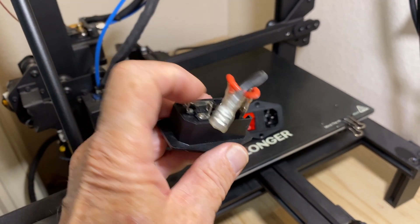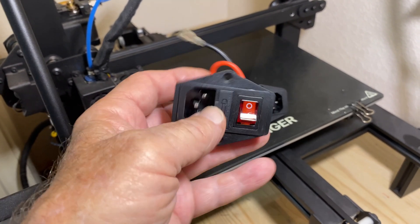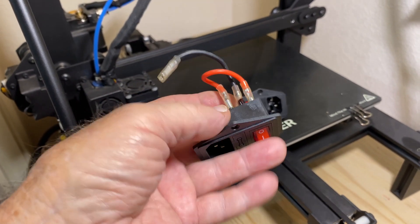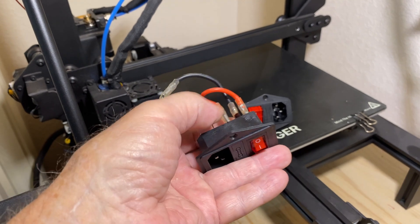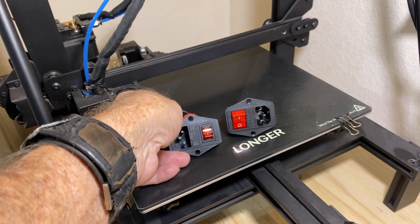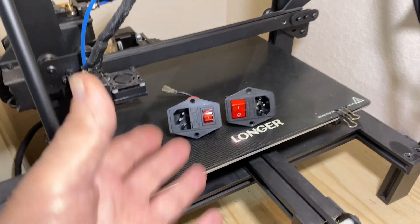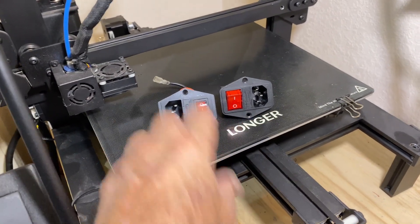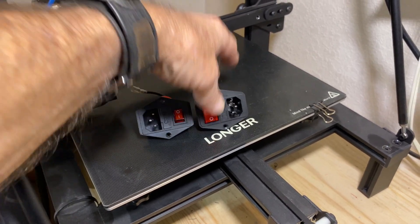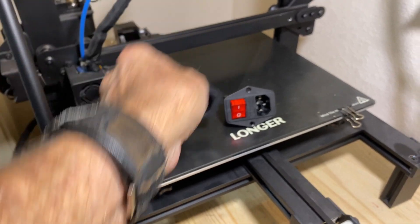What you're seeing there is burning. The other end, which you can't see here, is no longer used. I cleaned it up and reconnected to the new switch. The manufacturer figured out this was going on — there's actually a jumper to take the hot and jump it to the switch, which is a kind of fascinating way to do things. Here's the replacement, which you can get on Amazon — I'll provide a link in the description. It's a lot better, a lot bigger, a lot heavier, with a much more satisfying click compared to the original.